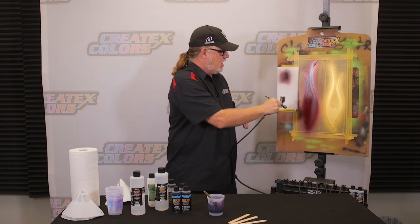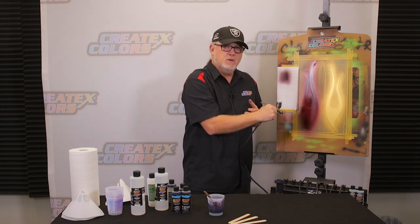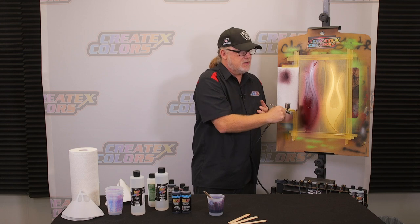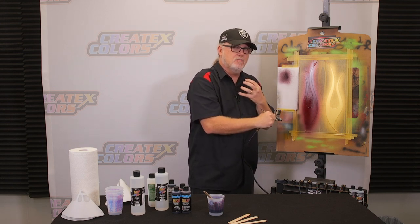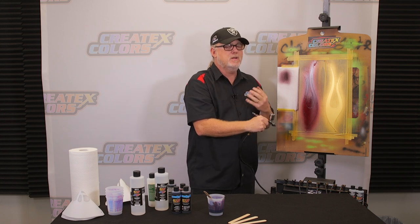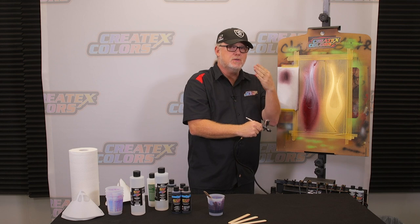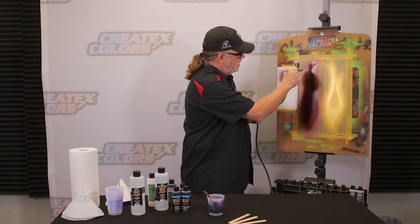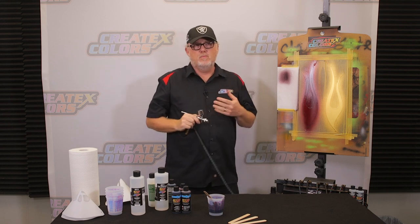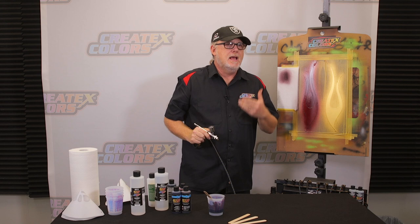I've noticed when using different candies, a buddy of mine, Dan Gardner, when he sprays his candy red, he noticed that up to 5 coats it has an orange tint, and he would say, man, I really want that bluish red, and I said, just keep on going. He went to 9 coats, and he's like, oh my God, as soon as I got to 9 coats, it flopped on me. I go, it got to a certain depth where all of a sudden that spectrum of light appeared to you. So, you know, now, would be better to modify and tint the color so you can get it within five coats.